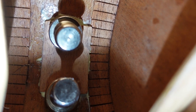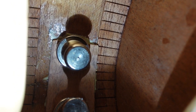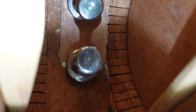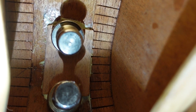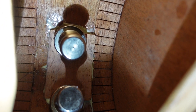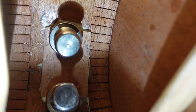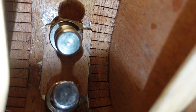Voila. All right, guys, there's the end result. There's magnets on the outside of the body that have tape on them, so we don't mar the finish, but there's enough glue in there to compensate for any gap in the curve, and we've got both ends tied down. We're going to leave this sit for quite a long while. Remember, the muslin is between the backing here and the plug, so if we have to do any fill from the top end, we'll catch it like a mesh.